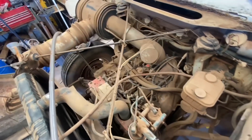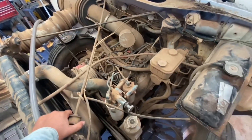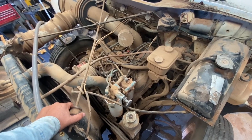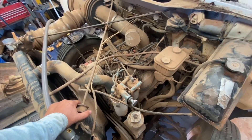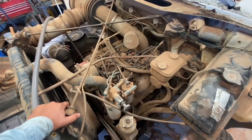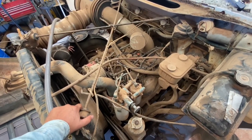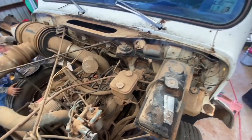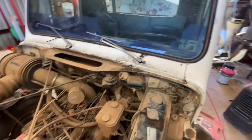The primer doesn't seem to be working. It's a big V8 — I think it's a 549, a 9-liter International V8 engine. Got an inline Bosch injector pump, I think a 5-speed with a 2-speed rear end. It's an International 1700, 82 model.